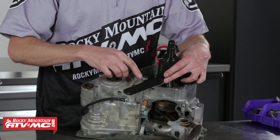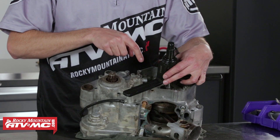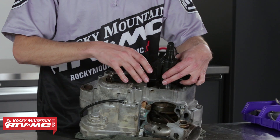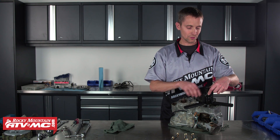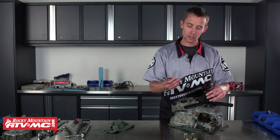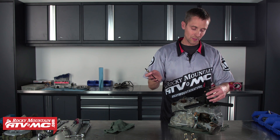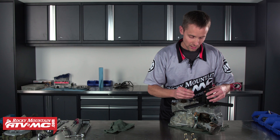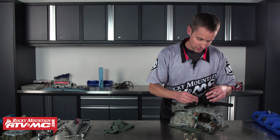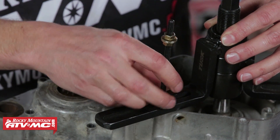I'm going to set this tool on and pick three mounting holes. In this case, this is a YZ250, and I'm going to use three of the holes that hold the flywheel cover on, spacing them out as evenly as I can. These three holes seem to work pretty good. Now, this tool comes with two sets of bolts — one's a 6-millimeter set and the other is an 8-millimeter set — so it depends on what your bike has and which holes are most accessible. This one's all 6-millimeter, so I'm going to install the 6-millimeter bolts in each ear.